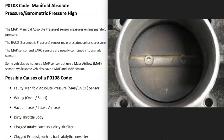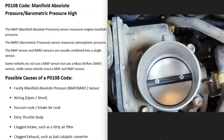Another thing that can sometimes cause issues is if the throttle body is really super dirty. If you look in there and that throttle body butterfly plate has a lot of buildup on it, that can throw these sensors off and affect how the computer responds. If your throttle body looks really dirty, you can get throttle body air intake cleaner at any automotive store, spray it inside, and clean it up — even using a small toothbrush. Quite often, doing that can help solve a lot of issues.